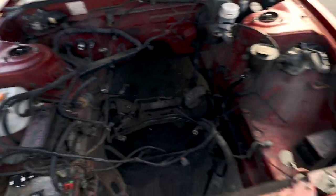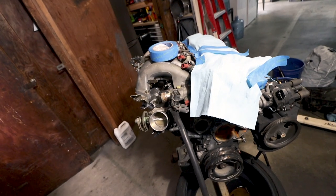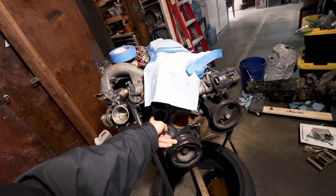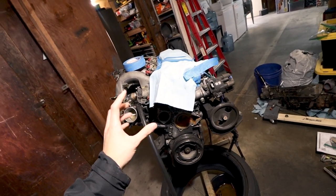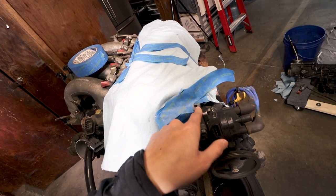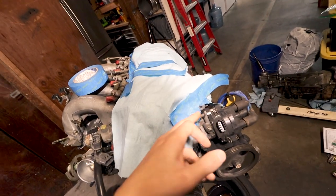Work here is done. I don't know if you guys notice the difference - this is all the stuff for the AC. There's a couple things I need to do today. All the water housing, the heater outlet, the outlet that goes to the radiator, the water pump - I need to get all those on. That's easy, just bolt on. But something new that I'm doing is installing helicoils in the valve cover bolt holes because one of them is stripped, and if I'm gonna do all the gaskets, might as well fix this too.